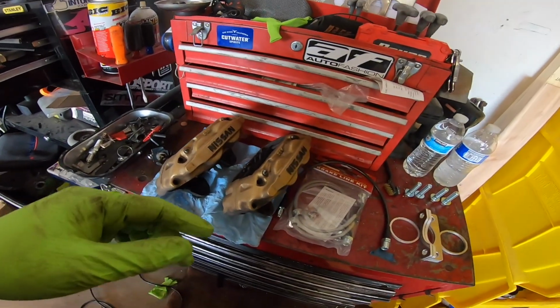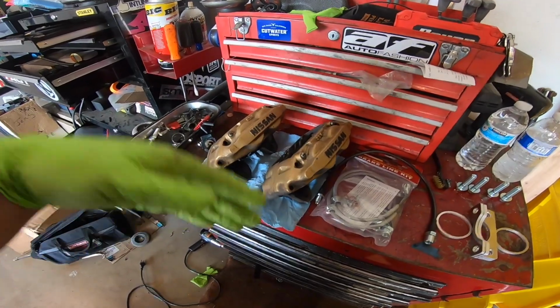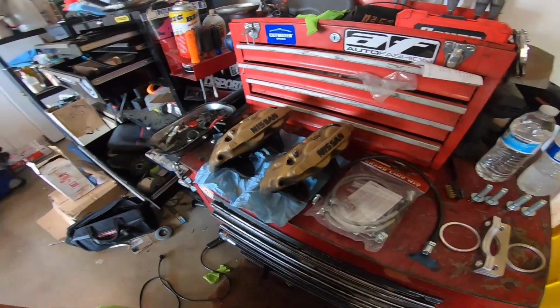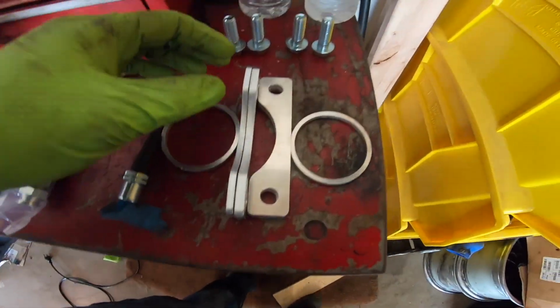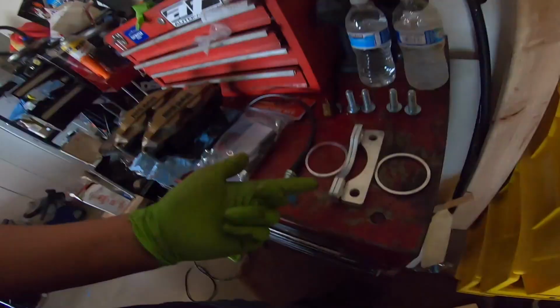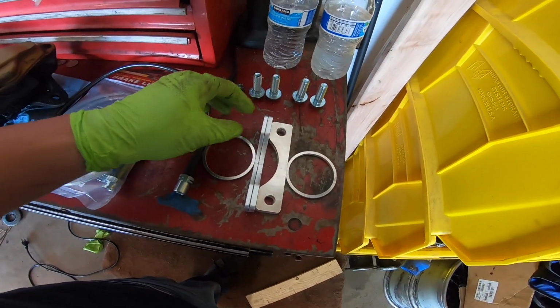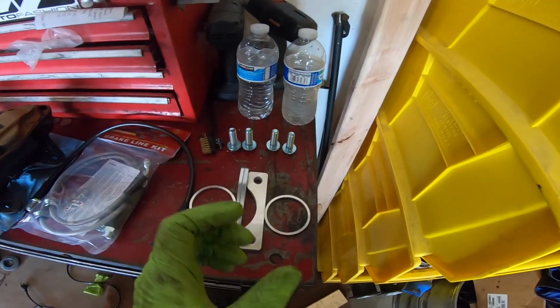All right, so basically what we have, these are Z32 four pots, just basic run-of-the-mill. I got them years ago and rebuilt them, so I'm not really worried about it. I got new pads and rotors, and then I have these adapters. These are made by some guy on Facebook. I think his name's Eric Held. I'll put his name in the description. But he makes these. They're real cheap. They're actually like a two-piece because some of the calipers need to be, the alignment's not right.